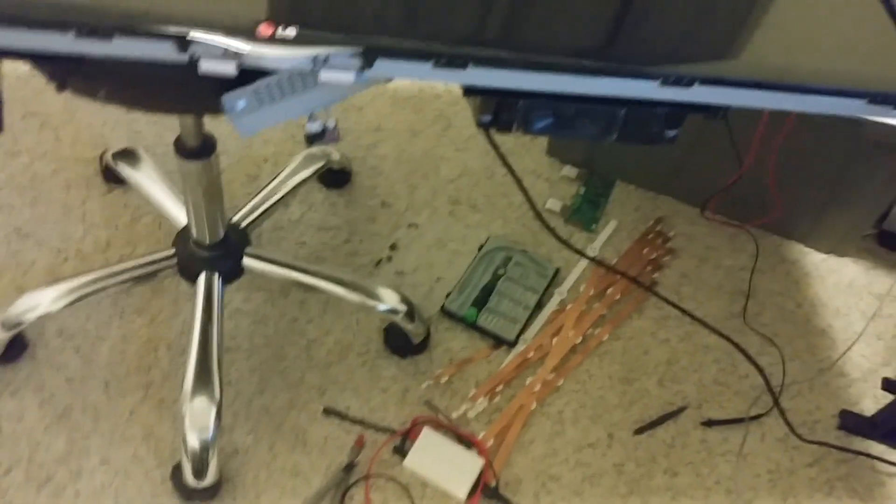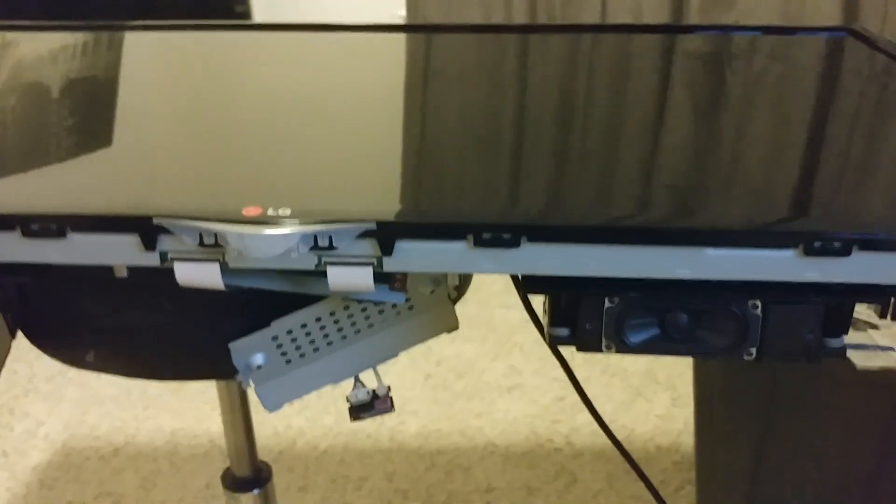So part of those LEDs I'm going to see which ones are bad, and most likely I'm going to be able to use them and put two TVs together to fix one and upgrade it. So I'm going to take it apart here. I want to show you — there are clips here that you first have to release all around, aside from the backing. After you do it all around, there are going to be some small screws, and if you don't use the right ones you will strip them, and then life sucks.